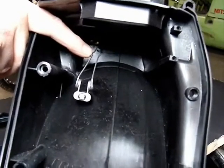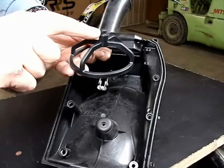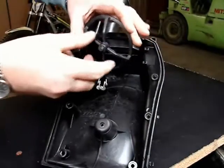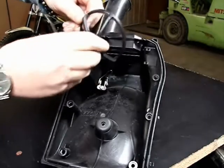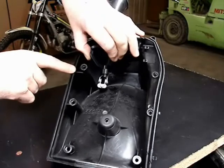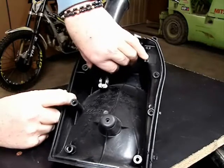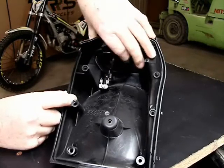It mounts against this little spring here. On the cage for the filter there is a small nipple that protrudes through a grommet on the filter, and that falls down into that spring. The filter is oval shaped, not round, so it must go with the narrow side side to side and the long side up and down, as I'm showing here. And the reason for this is because there is a lip on the interior of the air box that seals the filter.